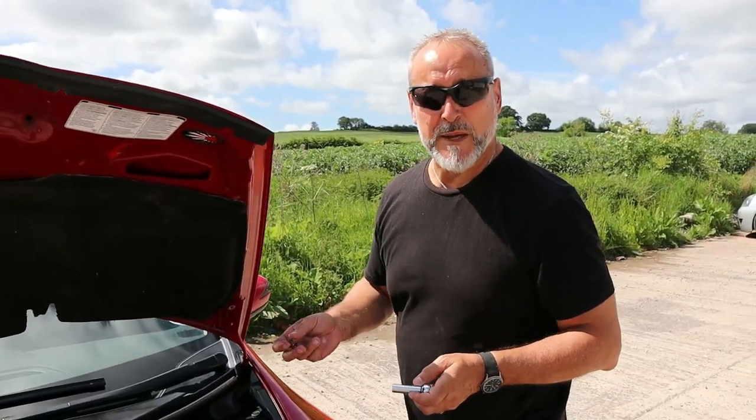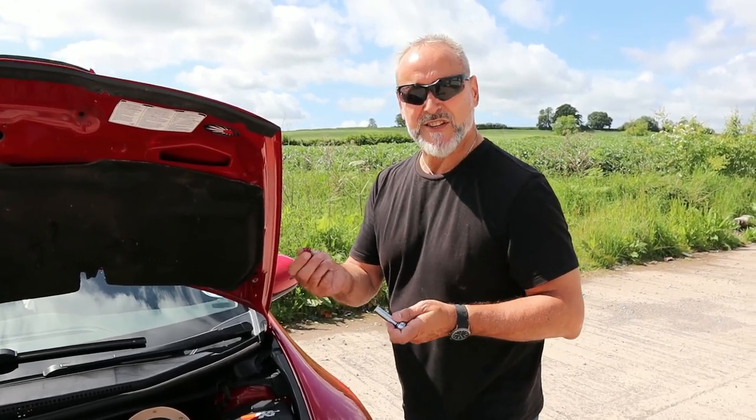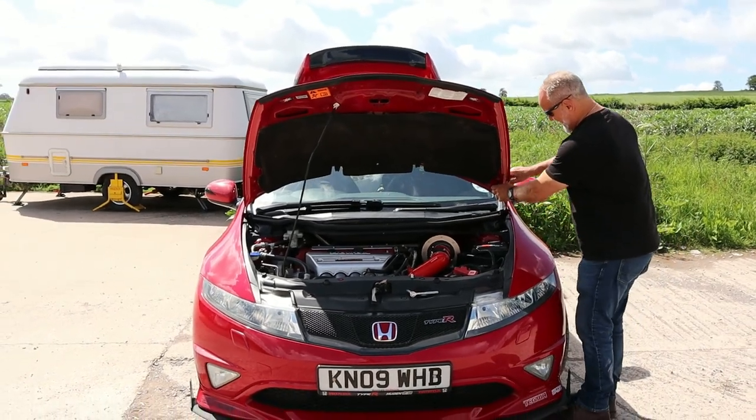That weight difference between carbon fibre and fibreglass - it's quite amazing actually when you pick the parts up. We're going to crack on and do a test fit of the bonnet whilst we're down here at Fiberworks. You've got two 10mm nuts either side - we sprayed them with WD-40 a couple of days ago to let that soak in, and they came off really easy. So we're just going to take these nuts off and try and get the bonnet off gently, because it's in quite good condition, and then do a test fit with the new fibreglass vented bonnet.